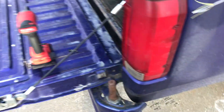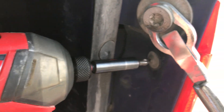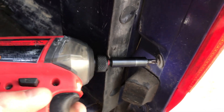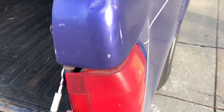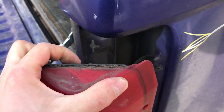If your tailgate is not open, you'll want to open it just like so, because your other two screws are right here in the jam — right in the door jam. There's one here at the top — so one and two. This one's in here. Now our taillight is free and it just comes right out like that.